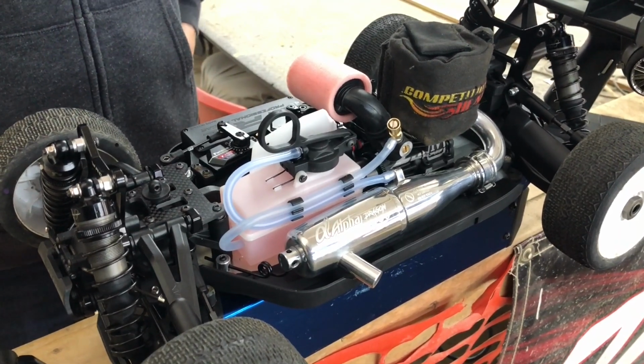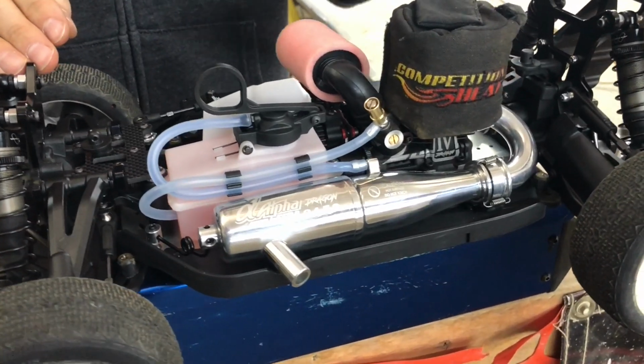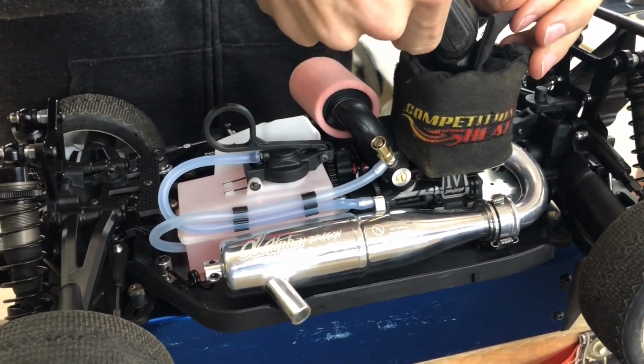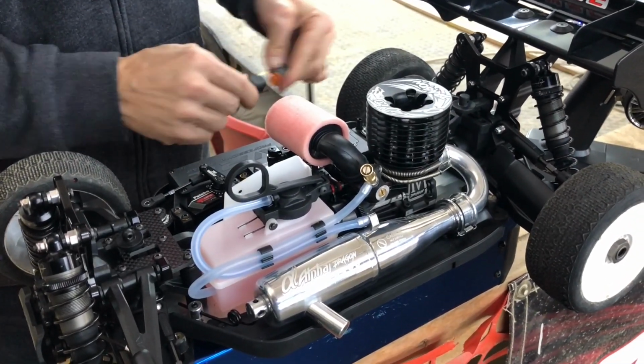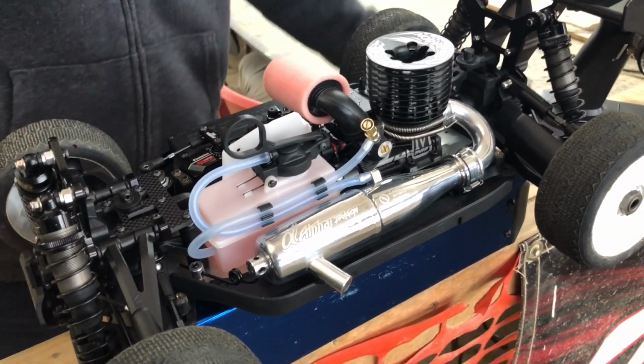Hey guys, Ryan Lutz here, and today I want to demonstrate breaking in the new Dragon 4 Edition 2 and how easy it is. So what I've done so far is I've preheated the engine. You can see we're a little over 150. That should be good enough to start with. So I'll take off the head heater here. Anything closer to 200 is probably better, but anywhere above 150 is a good starting place.